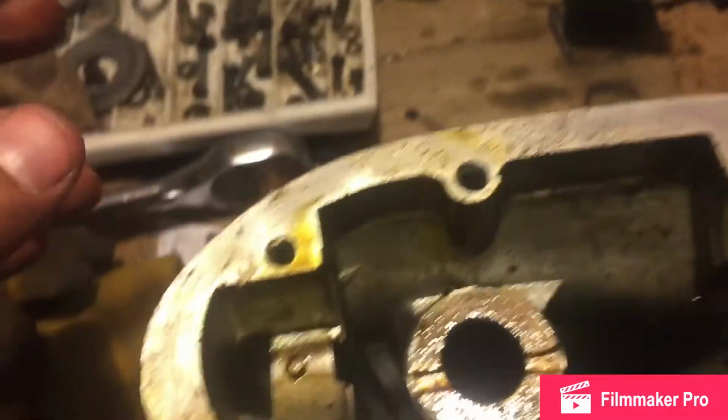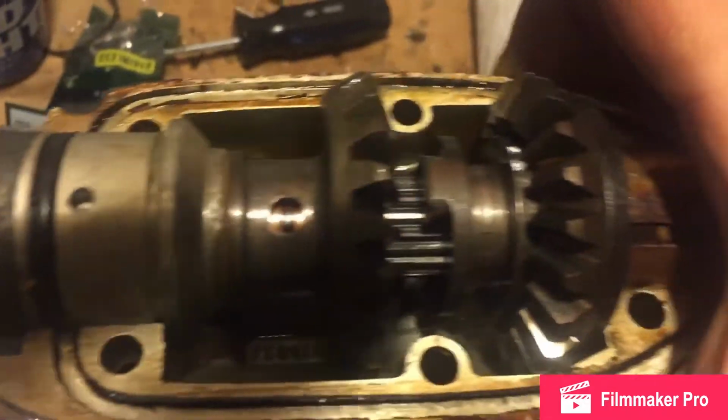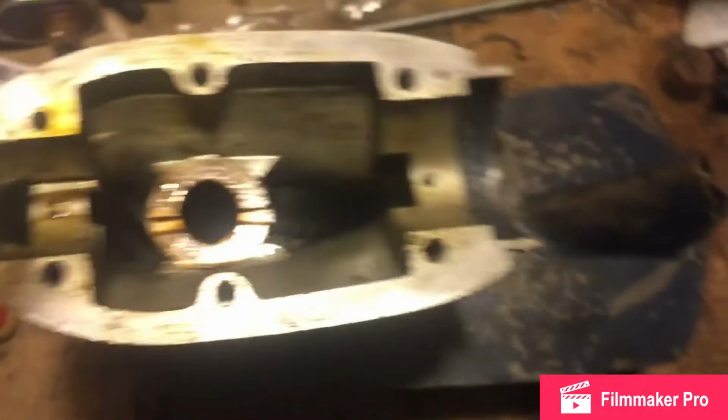Now we have to seal the skeg up. A bunch of videos on this as well. Nothing different here. I'm going to put the drive shaft seal in there first. New O-ring, spaghetti seal. I'm going to take it out and clean it up. I've been saving this for last because I'm afraid to not put it back together the way it came apart. Lots of pieces there. Okay, sorry for knocking the camera. So let's get to it.